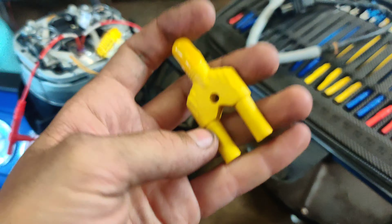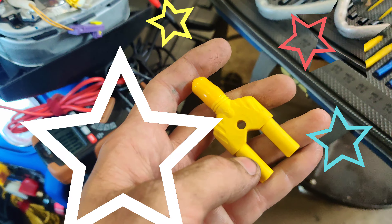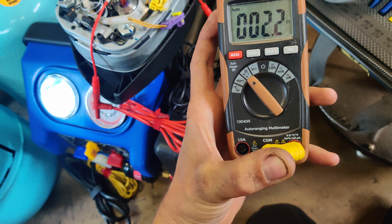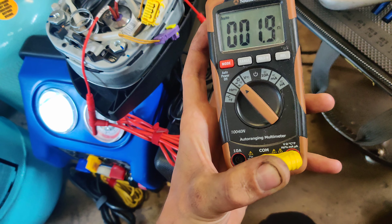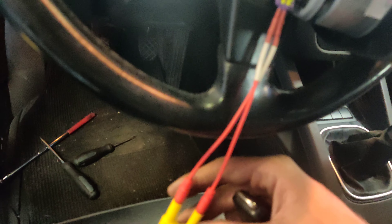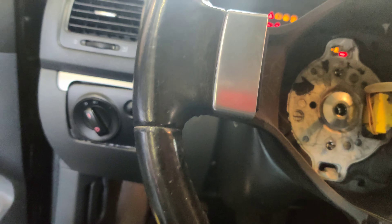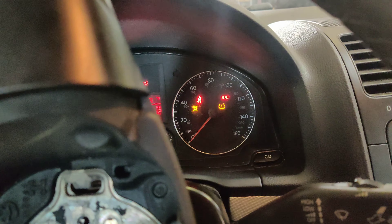So I couldn't find a resistance value for the airbag, and usually they're between 2.1 and 2.4 ohms I think - I could be wrong. I know it's 2 point something. So I used these 0.64 female terminals and I put them over the pins for the airbag. You can see how it's OL right now. So when I put this on, you can see it goes to zero - it's almost zero the whole time. That's really, really low. I'm pretty sure that's what is bad. So we have these resistors and these airbag pieces right here, so we're going to put one of these in the car and see if the car likes the resistance value of these.